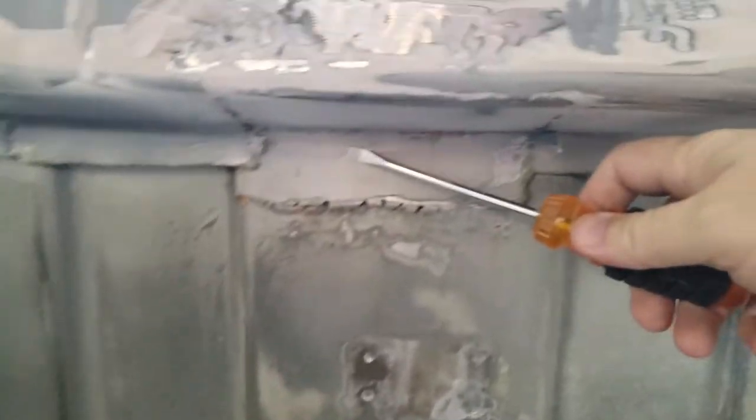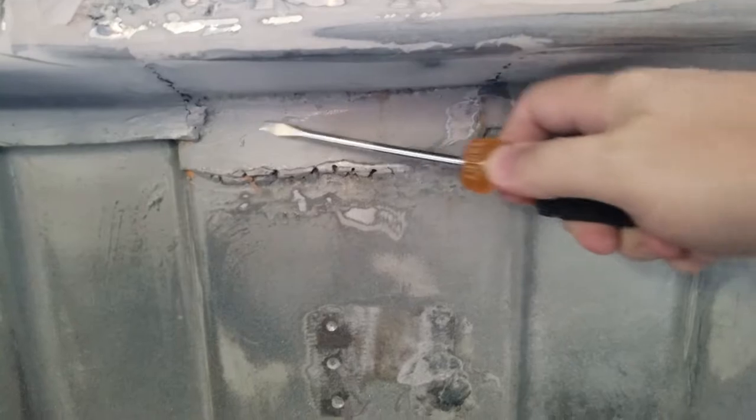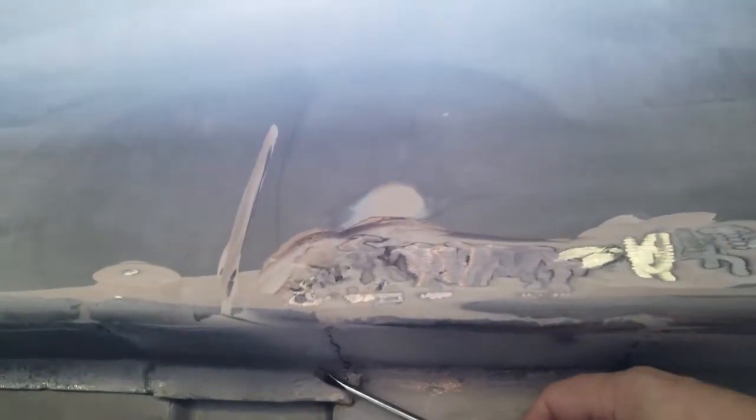I find this on the back, and I gotta say, I was not impressed. It's a half inch thick of nothing but mud that someone laid all the way across instead of actually fixing the issue. Which tells me this metal is probably foobar. I can see down here all that was re-welded with extra pieces in, making it all look reattached. We got all kinds of rot there.